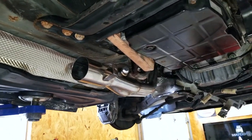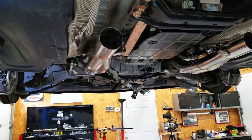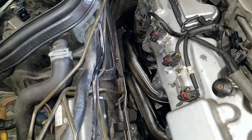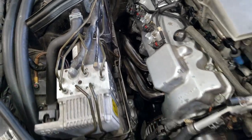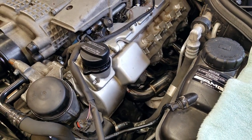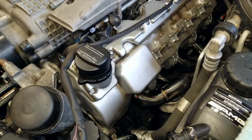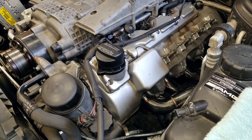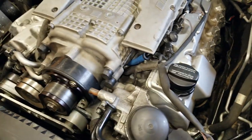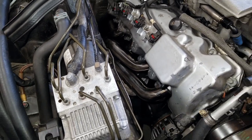Here's how it's going to look, minus the piece of wood. Let me go bolt these things up completely and then we'll take a look at what we have to do to get the rest of the exhaust bolted up. I just wanted to show you guys what these look like from up top — they look really, really cool, although they will change colors after a few heat cycles. These are all tightened down, and don't feel bad if you can't get a torque wrench onto every single nut — it's nearly impossible. I'll leave the torque spec in the description, but basically don't go too crazy on these little tiny nuts or you will strip out the studs.